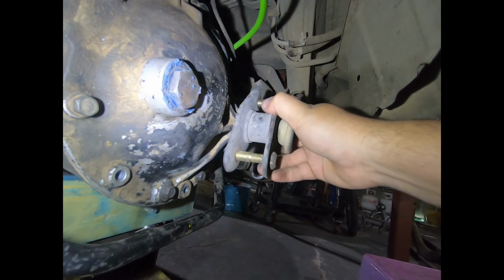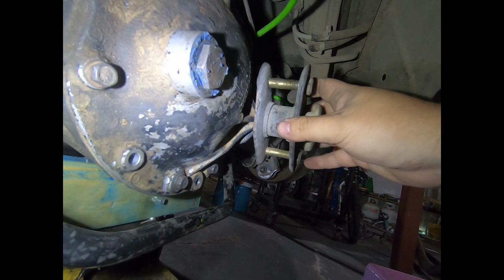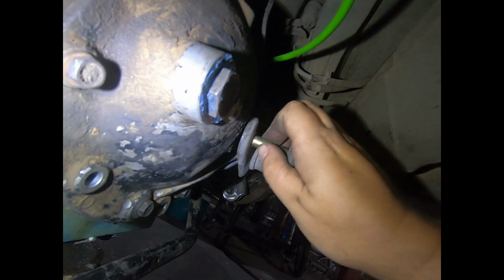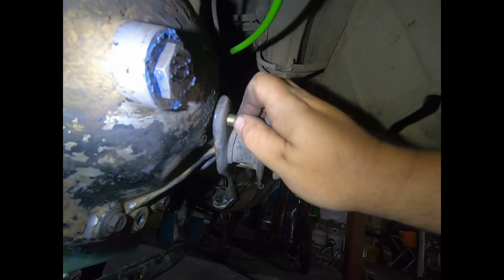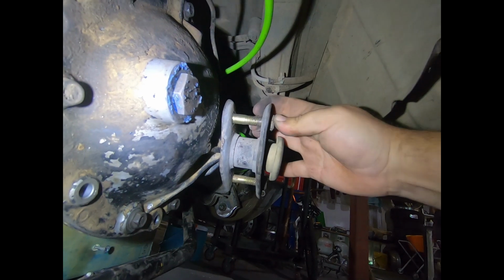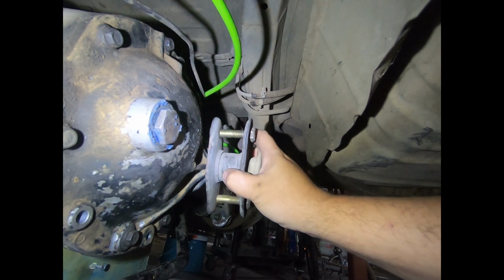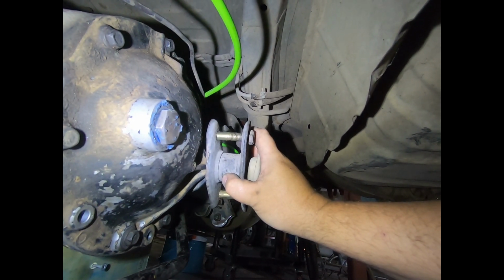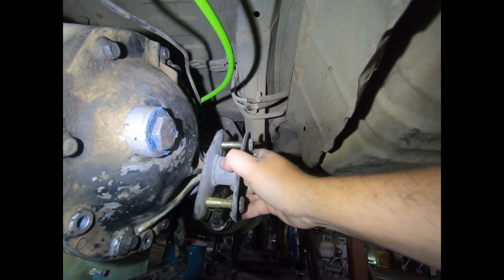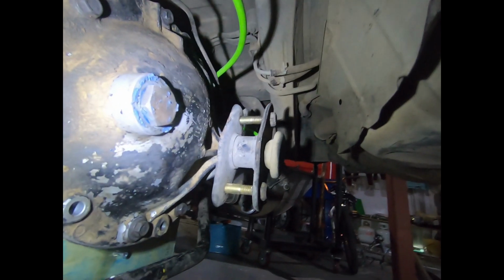Another thing to notice is that on this cam, it's got some low profile bolt heads and some big nuts. So you'll have to have that orientated so that the low profile bolt heads are on the cover side so they can swivel past the cover, just. It's probably like 3 mil in there, but if you had the nut on it, you wouldn't be able to get it to swivel past. Ideally, you want it in the car, I reckon, pretty much up or down, or like 15 degrees over at full bump, just so you can get it to wind back on full droop and you have that big range of movement to allow the car to go up and down uninterrupted without this binding. But that's fine.